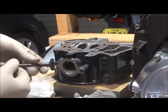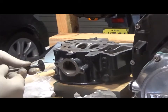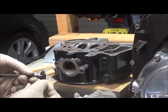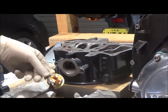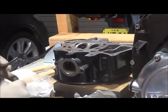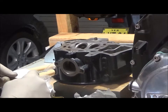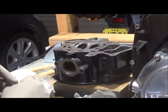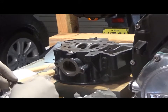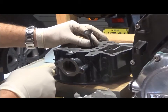I'm going to check the valve stems. I checked the springs — everything looks to be quite good. The cuts in the valve seats look to be quite good too, so I'm just going to apply some lapping paste on them and I'm going to lap them.